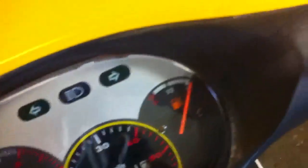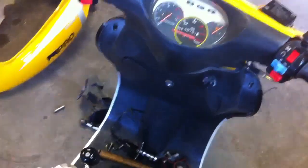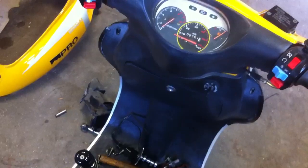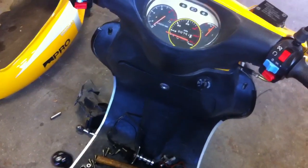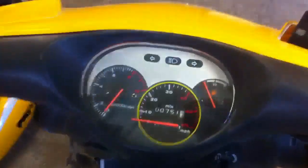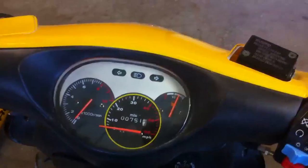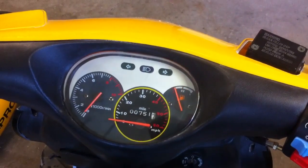The fuel reading is full. Let me show this in real time — so we got the float mechanism down here, you see the gas gauge. And then as you move it down, the gas gauge is supposed to go down — so now it's all the way down and it's showing E. And then I'll put it all the way back up — full. So let's go all the way down and all the way up.